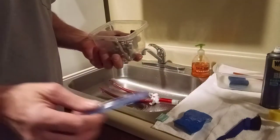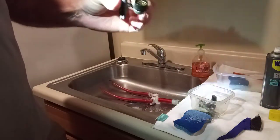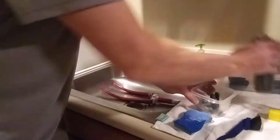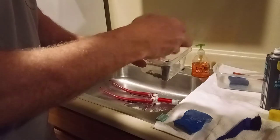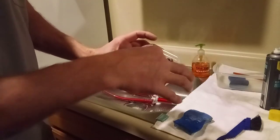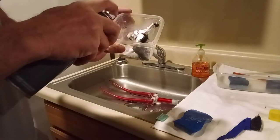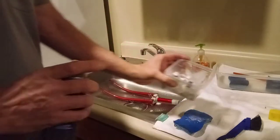The other parts — I always keep all the parts in little containers. We have some brakes and inside of there there's a lot of dirt, grime, and grease, just dirty from being used. So what I like to do is just put these in the cup and take some of either this or the Simple Green — a good dousing with that foaming cleaner. I like to put the part so the greasy cup faces up, then I just spray them down, flip them over, give them a good coating so everything in there is coated, and I'll just leave the lid on while I'm cleaning other parts.